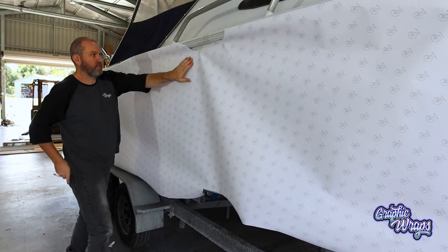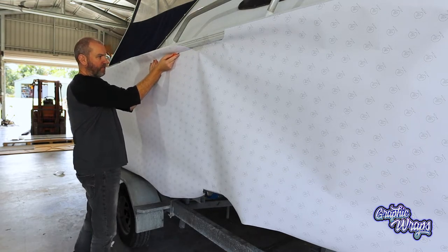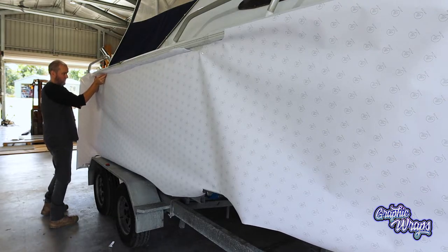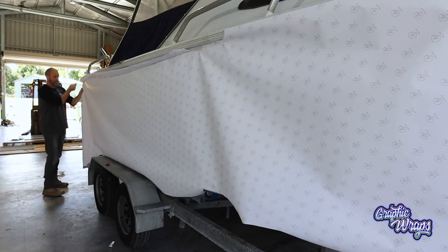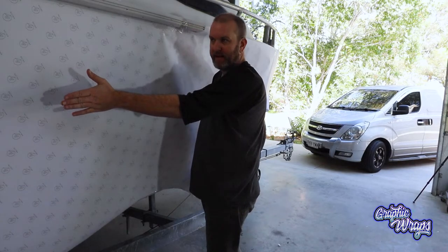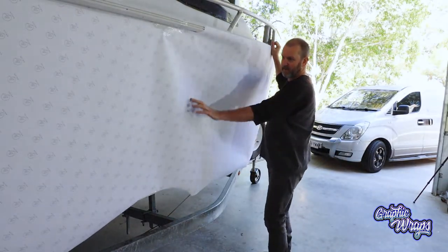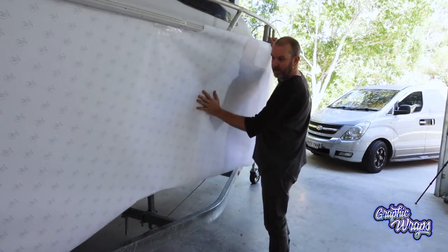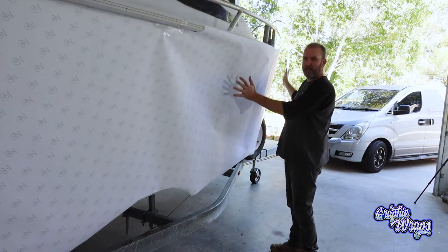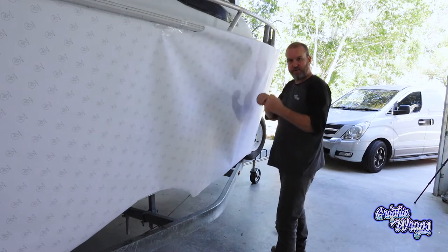I like to hold it in the middle of the film and pull it until it's as straight as possible, then tack it off on the top. Now I'll cut this down — I'm not cutting onto the boat, just cutting the paper. You can see it's nice and flat at the back. Up near the bow it's puckering, so I'll lift the front off and let the paper swing up to follow the bow shape, then lock it on and trim it to suit.